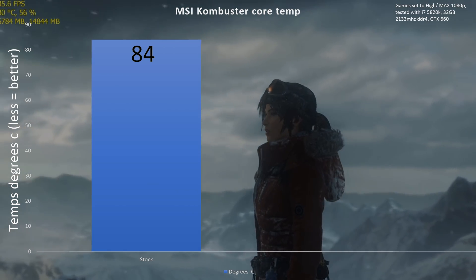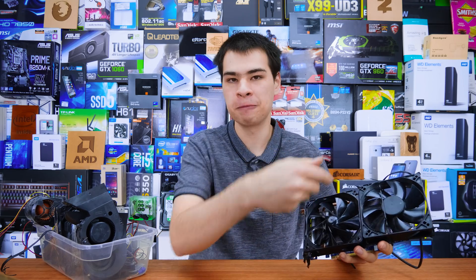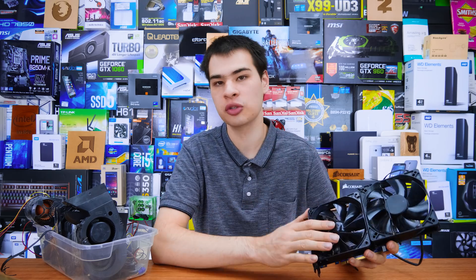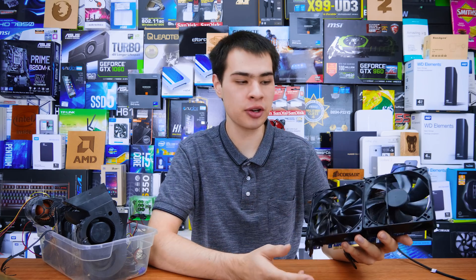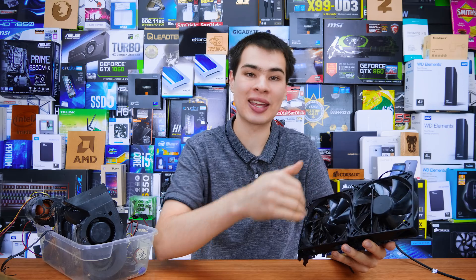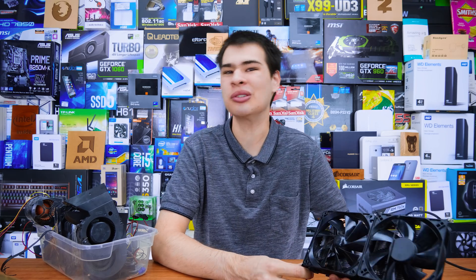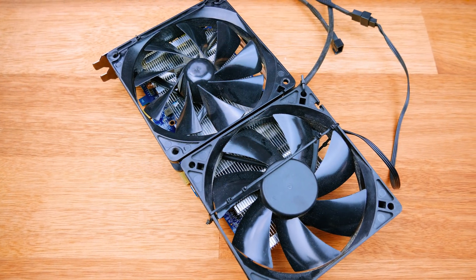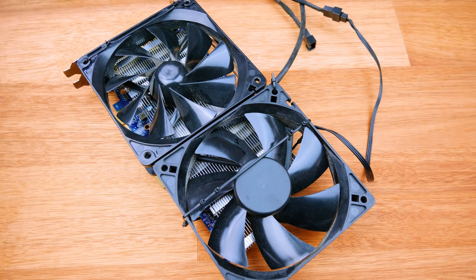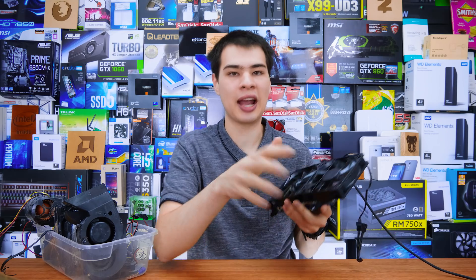First up, we used the two fan design. This is something I've seen a lot on websites and forums where people just strap two big 120mm fans on there. Both of these are static pressure fans, which is exactly what you want — you want pressure going into the fins rather than just an airflow style case fan. Now at this point, I was not exactly convinced, mainly because looking at the shots above and below the actual fin array, there's quite a bit of spacing. I was worried the air was just going to pressurize and fall out the edges, and especially on the second fan where there's a lot of overhang, I was worried a lot of the air would just fly out the back. But let's take a look at the performance.